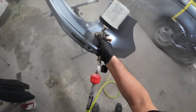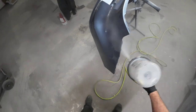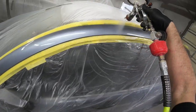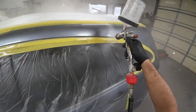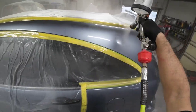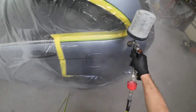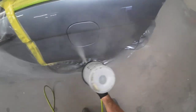I've always been a fan of Iwata, and I really like how this gun performs. If you have this gun, let me know your thoughts down in the comments below. After about 15 minutes, we're ready for our second and final coat of clear. I'm going to hit it a little bit harder by spraying at the same speed but about an inch closer than before — this puts more material on the panel, helps it flow out better, and gives us a nice flat finish. Whether it be equipment or materials, I'm always looking for the best value for my money, and I can't argue with the performance of the Iwata Kiwami 4 at a budget price of around $190 — under $200 — you're going to get an incredible gun that puts out a beautiful looking finish.